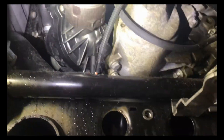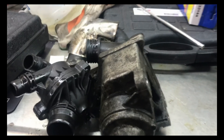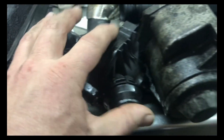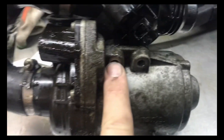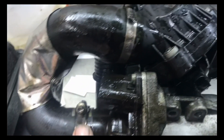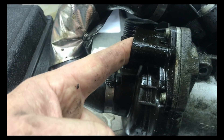There are two bolts there and there that hold the water pump housing in. Then there's that hose connection I have to take off, and there's probably another hose connection in the back. Here's the whole assembly out of the car. You've got a bolt up top and two bolts down below. The thermostat, which is this whole unit here, bolts onto the unit. Two bolts here, and it's got this hose that wraps around. You cannot get to this hose clamp in the car, and the electrical connections here are very difficult to get to on this car.